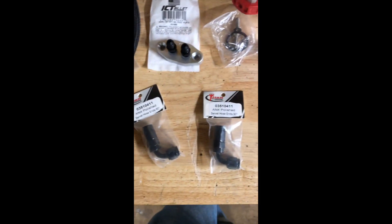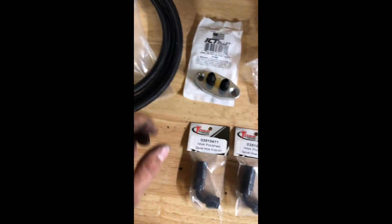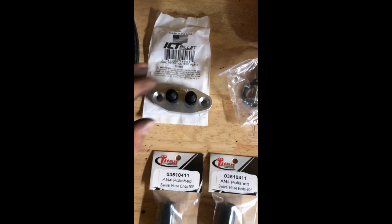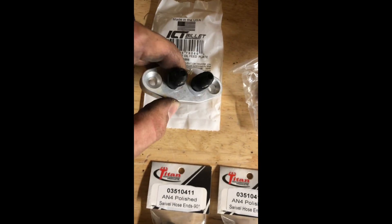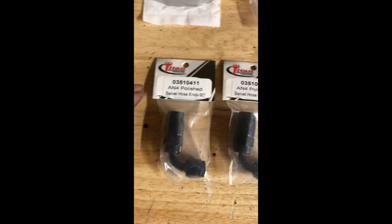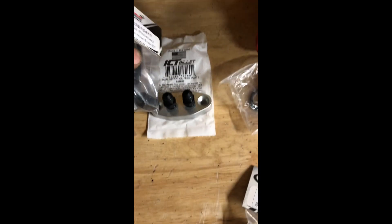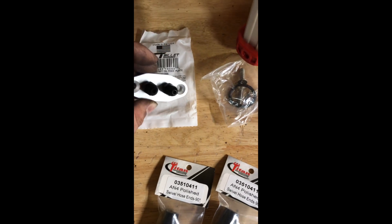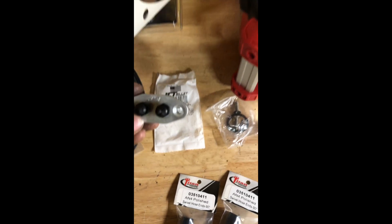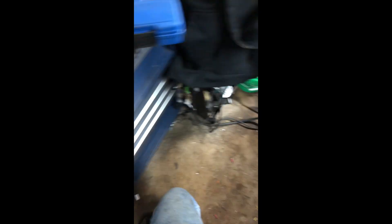Here are some of the parts I'm using — I've got Titan brand from my local race shop for AN fittings, and then I've got ICT Billet here with the dual feed part number. I also got these 90-degree fittings from my parts store. It looks like I'm going to be running 90s pretty much throughout the whole thing — a 90 sitting off the oil filter. On the six-liters there's actually a plate used for oil cooling that goes to the radiator; I've gotten rid of that and have a block-off plate.